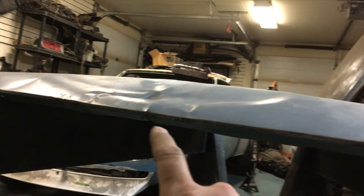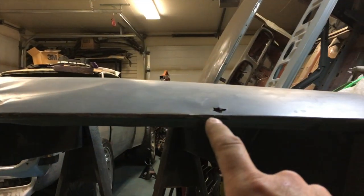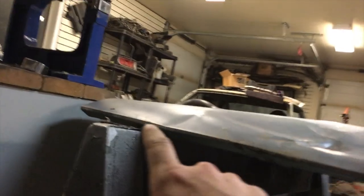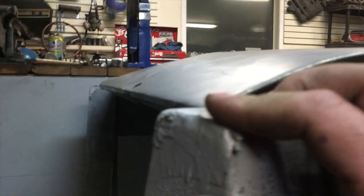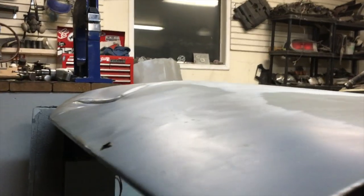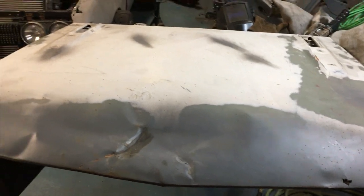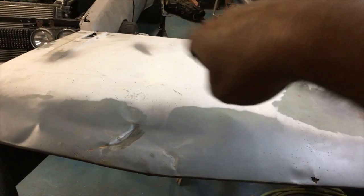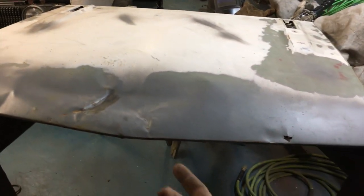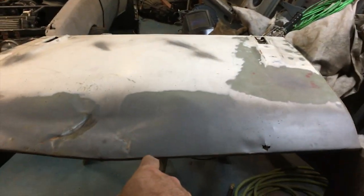Once I pushed this back, I still had a piece where this pushed the edge down on both sides. Now if we look down there, I think we're fairly close already, but that edge has now worked. I just have to use the unispotter or stud gun to get this area fixed right here, and then we'll have a more usable hood on the race car. I was getting clearance issues on that point on the grill — now it should clear.